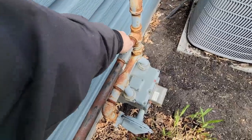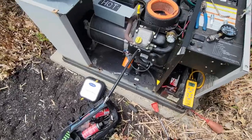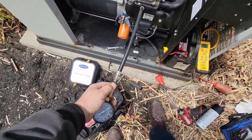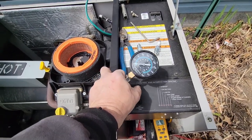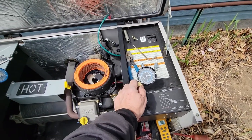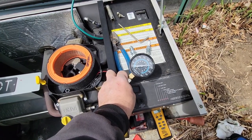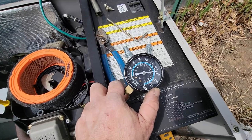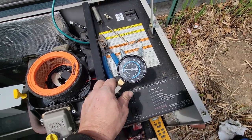Let's go ahead and grab the compression gauge - I don't see a whole lot wrong with the spark plugs. Let's turn the fuel back off, don't really need fuel running through the system. Got our hose hooked on, let's put our quick-connect coupler on there and see what we get. We'll probably be about 195 to 210 - I forget exactly which one this is, it's usually around 210.